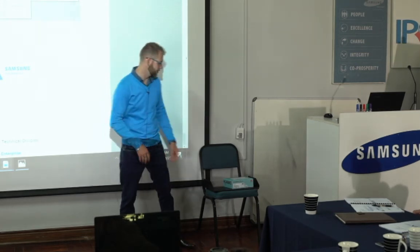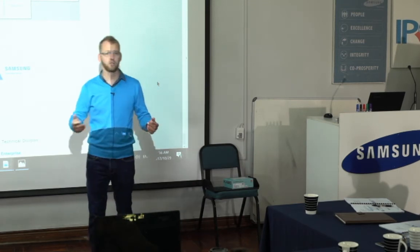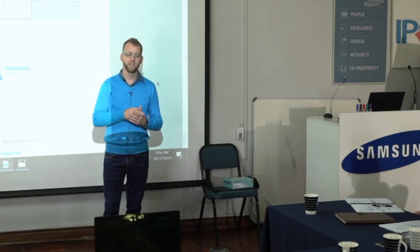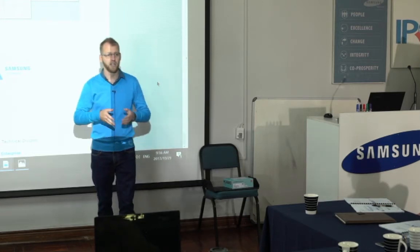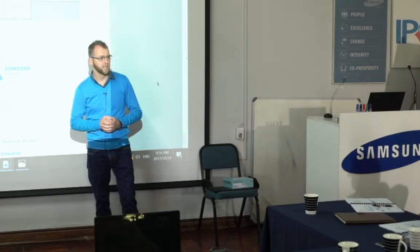For example, if you get an install with an iServe solution, or your phones come up and they say DHCP fail, you log into the device that's giving out DHCP and you go and see under the leases what's happening. Is any other device not getting an IP address? Is it just that particular device? Plug your laptop into that device and see if your laptop is getting an IP address.